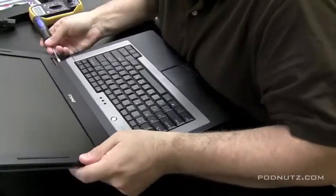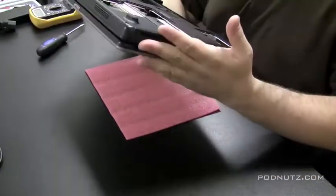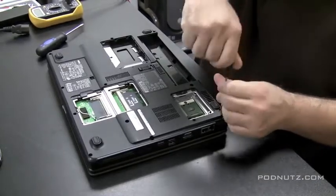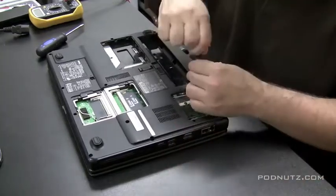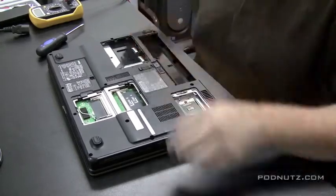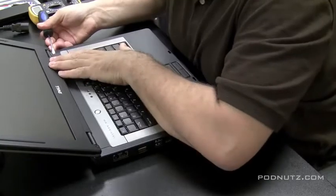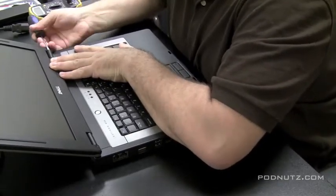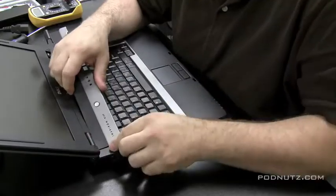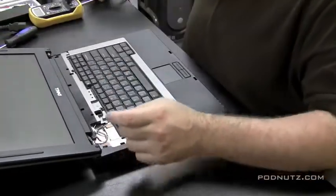The key to working on laptops is, in my opinion, to get the motherboard out - and to do that you want to get the screen and keyboard off first. The key to getting the screen and keyboard off is removing that plastic flap that sits right above the keyboard. Sometimes it's screwed in from the bottom, so I'm taking all the screws out anyway. On a lot of Dells there's a little tab on the right-hand side - put a screwdriver in and it pulls right up. Getting up right under the hinge with a flathead screwdriver is a good way to do it. Don't force it if it won't come off - there are probably screws holding it in.